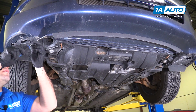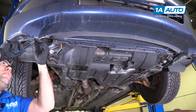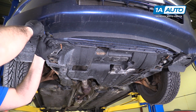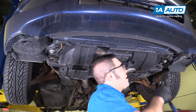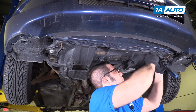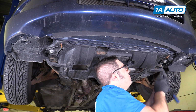They get filled up with dirt. Sometimes they're hard to unlock. Just pry them open with a small flat bladed screwdriver, then get the trim clip tool in there. Kind of work them open. Work along the edge, find all the clips, pull them out. They might break. You might have to replace them. They get brittle with age.